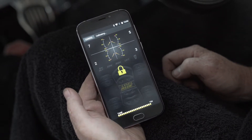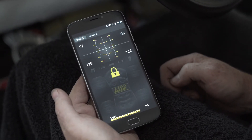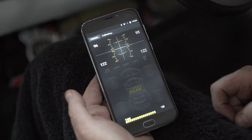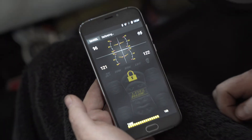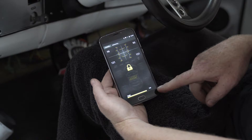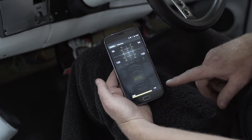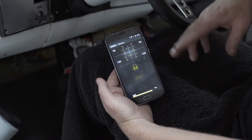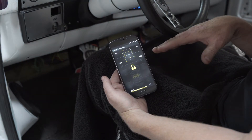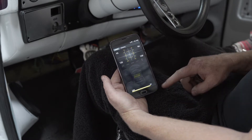When it can see that there is no further decay in the bag pressure, it will raise the vehicle up to around 40% of the travel it's measured. You can see the vehicle has now come back up — we're roughly at 40% of the travel. The compressors will turn back on, and while the compressors are running it won't make any adjustments. You'll have a period of time waiting for the tank to refill, and once it refills the process will keep going.